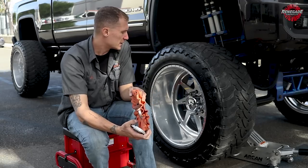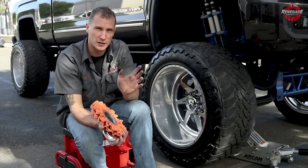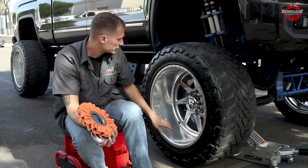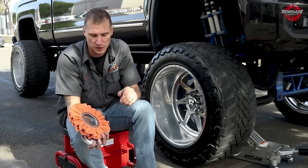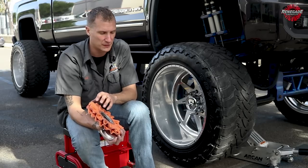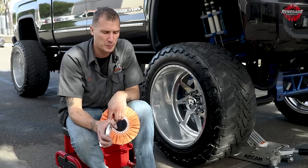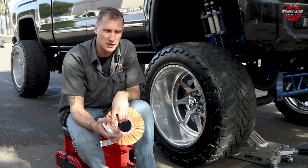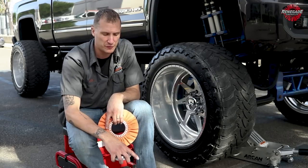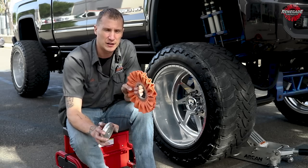But what I do when I go to polish with the 6,000 RPM grinder is I'm gonna work it in, start at the center, work my way all the way to the outside, and I'll work the outside, because once in a while you'll catch that outside with a flange or with the end of the shaft, and you don't wanna be banging that stuff around, you have to clean it back up again later. Your average everyday guys, your 3,000, 3,500 RPM will do all these same steps. I'm gonna do everything today at 6,000, except for my final step. My final step with the white flannel and the green, I'm gonna run that at about 2,200, 1,800, right in between there.